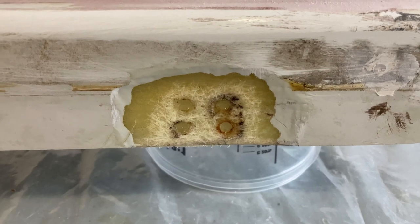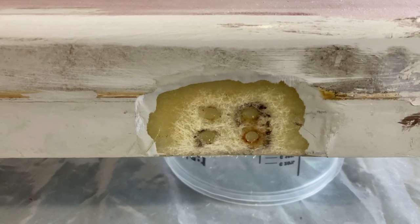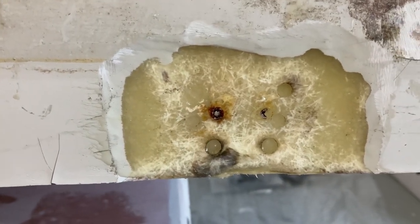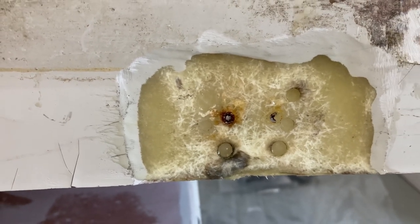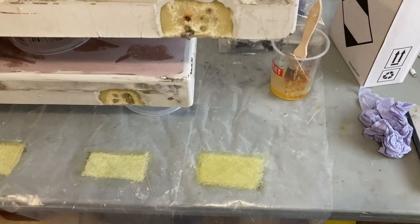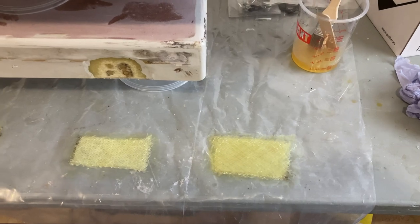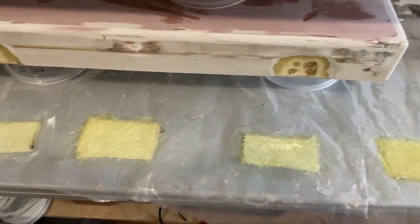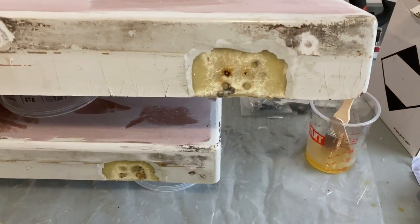What highlights the fact that these areas need reinforcement is that now I've laid some resin on top, you can see the glass around the edges is normal colour, but the area where the fixings have gone through has been flexed and stressed over the years and has got that slightly lighter colouring. The way I quite often do repairs like this is to lay the glass up and wet it out on a piece of plastic like this because it's just much easier and quicker than trying to do it on a vertical surface. Once everything's wetted out, I can pick those pieces of glass up carefully and smush them into place where they need to go.